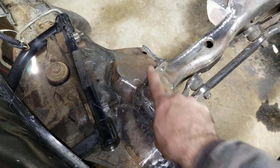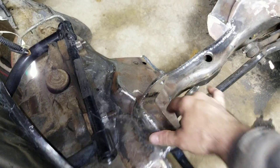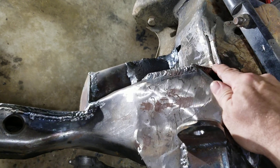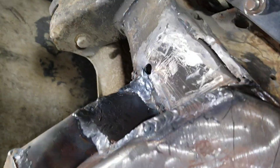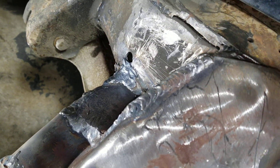These brackets here I built myself. They're all welded in — everything has been welded in on the backside and pretty well smoothed out. On this one here, where it originally had a plate, I have taken it completely out and it's welded fully, boxed in all the way down through. I noticed that I did not put a weld in here, so I will go and put a bead of weld across here and make sure it's fully filled in.